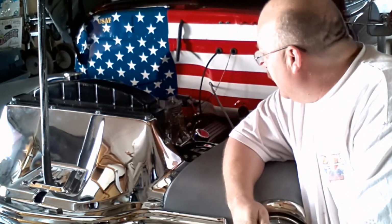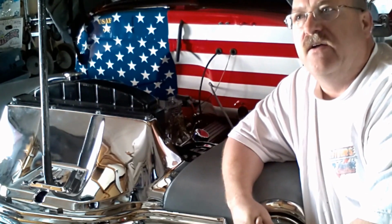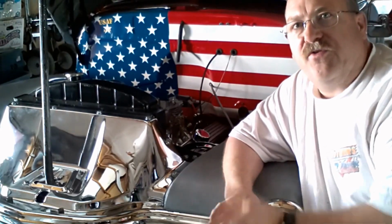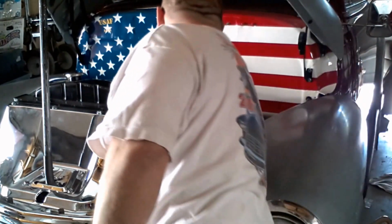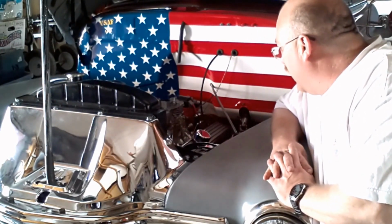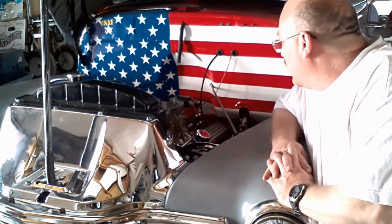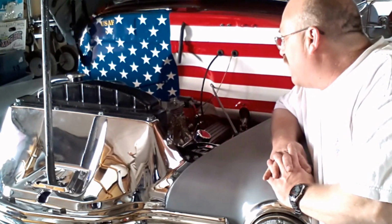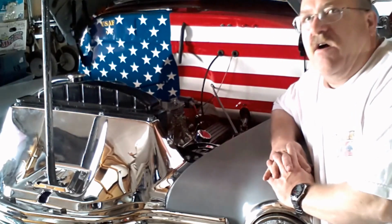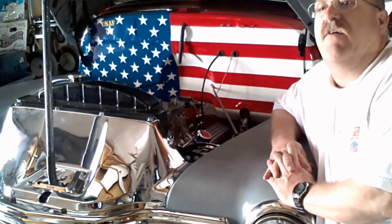I don't know if you could hear it in the video, but it's got some sort of a clatter to it. It almost sounds like an exhaust leak, but I just checked both sides, both headers, tightened all the bolts. They were not quite snug. I snugged them all up. Also, the pulley on the water pump was loose, and it still has a little bit of play in it, which isn't right, but it's not leaking, and I don't think it's making that clatter. The only other thing I can think of is I've got two of the valves adjusted in too far, or the rocker arms adjusted too much, and they're letting the valves hang open.